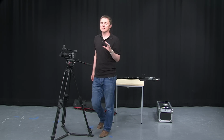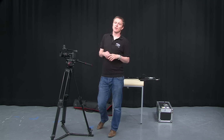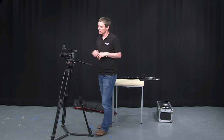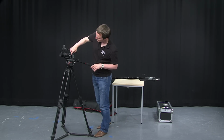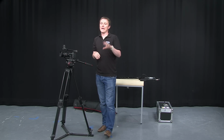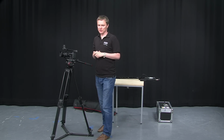Under no circumstances try and force it. We've had students in the past force these cards, and that damaged the slots to the point that they're no longer usable, which is perhaps why this card is in CFB instead of CFA. Whether you use slots A or B is irrelevant, although if you've got two 16 gigabyte cards, you'll probably be using both.